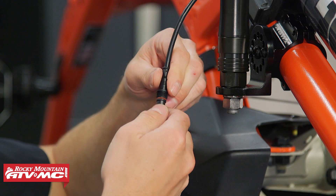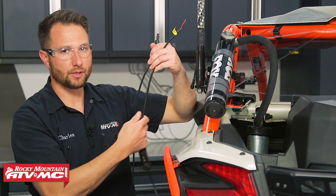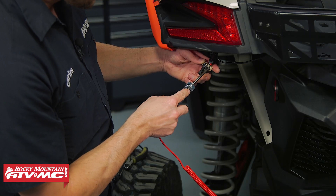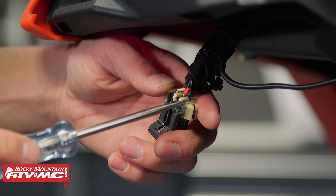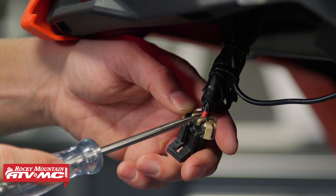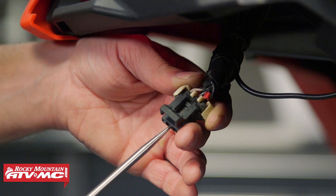For the wiring, both of the flags come with a little wire harness attached. Disconnect both of them — we're only going to use one of these wiring sections, on the driver's side, and remove the other. Next we need a power source for our lighted whips; a common place to get that is from the tail lights. Disconnect the driver's side tail light connection. On this connector you have three colors: white with a red tracer is your brake lights, purple with white tracer is key-on power and that's what we're tapping into, and black is your ground. We're tying into the purple wire for power and splicing into the black one for ground. If you aren't sure, you can verify all of that with a test light.